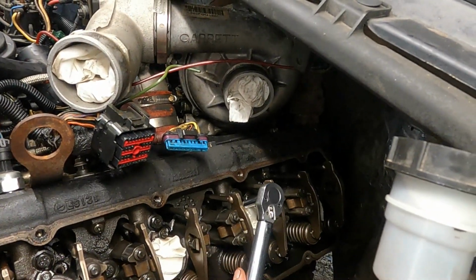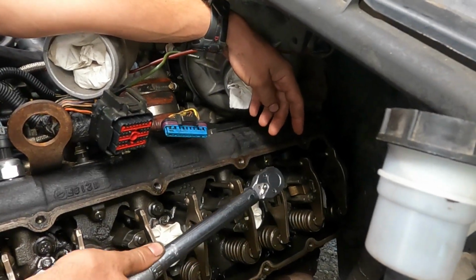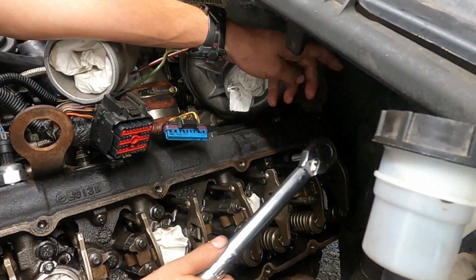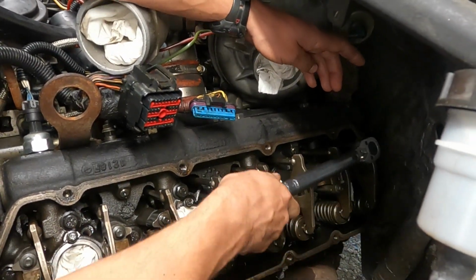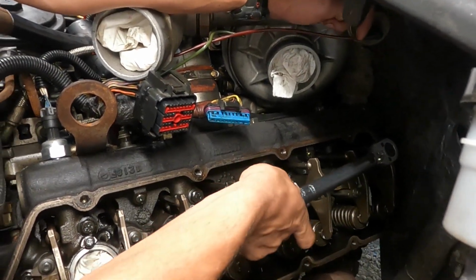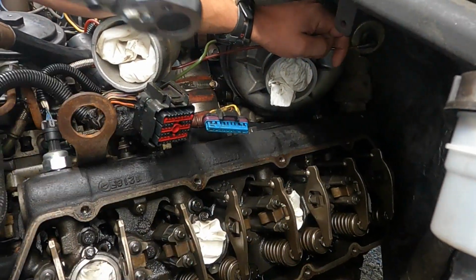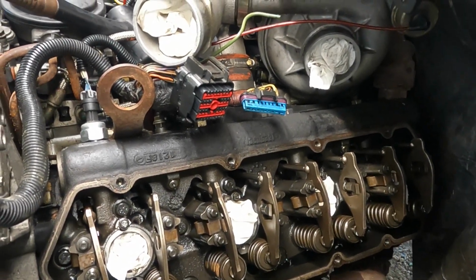What's your torque on that? 10 foot-pounds. So I got a quarter inch torque wrench, that'll be 120 inch-pounds. So if you're gonna convert foot-pounds to inch-pounds, you gotta what, multiply by? Yes, times 12. Okay. 12 inches in a foot.